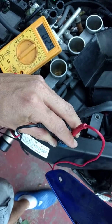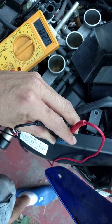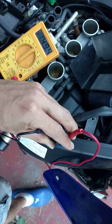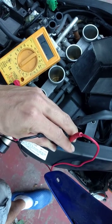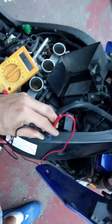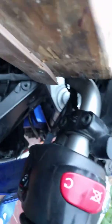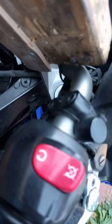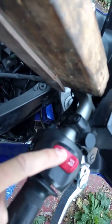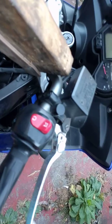But watch when I let go. My pinky that's holding the camera is also holding the kill switch down. I keep the kill switch in the on position and let go — the ohms go pretty high, which is why I think my bike is turning off while I'm riding. I'm pressing this down, just doing this, and that's making the reading change. So I think that means I have a faulty kill switch.